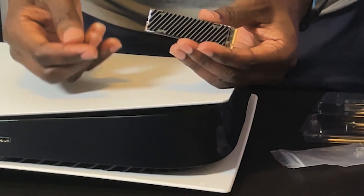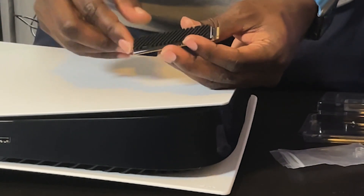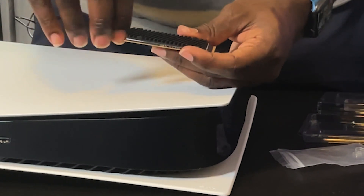I got a little bit of the adhesive over the screw hole, which isn't a big deal, but if I had moved the heat sink back a little bit more I would have to reseat it completely. So just be cautious when installing your heat sink to watch out for the groove where the screw goes. This heat sink actually did start moving around on me, so I am going to have to use the included rubber bands. I really don't like that solution, but this was a $10 cheap heat sink and I'd rather have it secured than risk it falling off.